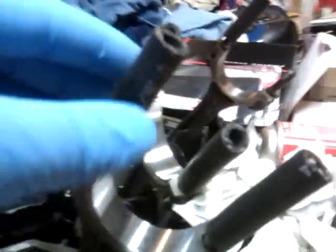You see I've got rubber hoses on the end of these bolts. That's so when you put the pistons back into the cylinder hole, they'll come up, and where they meet the crank, these won't scratch the new polished crank.